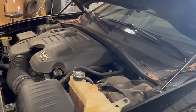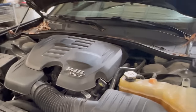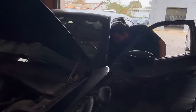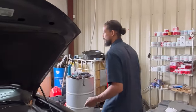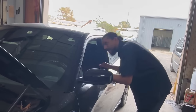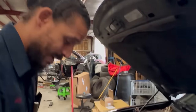I'm going to reverse and check the other side as well. The driver's side motor mount is shot. I always like to replace them in pairs because they're probably both dry-rotted. This vehicle has about 211,000 miles on it, so quite a few. And I don't hear a Pentastar tick, so that's a plus. We're already starting off on a good foot.